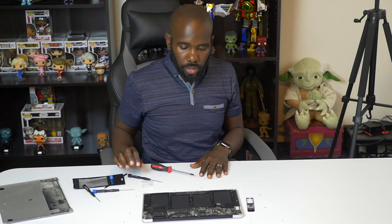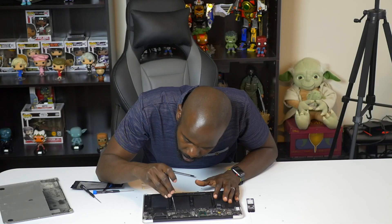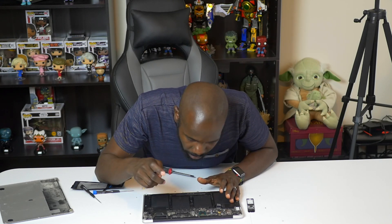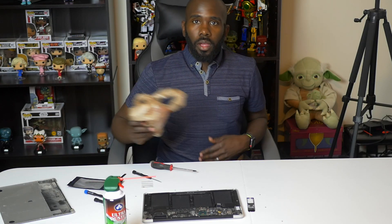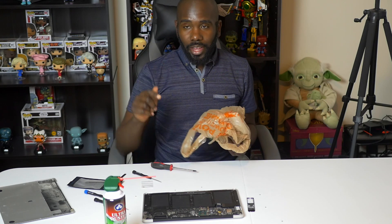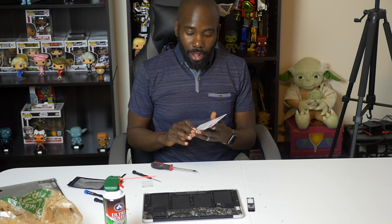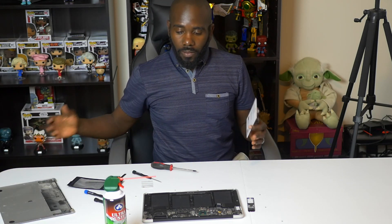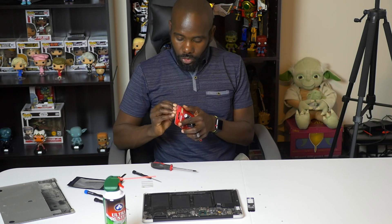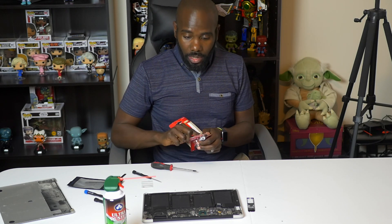This is installed on the board, but I'm having an issue — apparently this might not use the same size screwdriver, which would just suck because I came all this way for nothing. I had to run to Home Depot and get the right screwdriver to remove the hard drive because I didn't do enough research. The outside uses Apple's weird proprietary screwdriver, and the inside uses a regular T5 Torx screwdriver, which I didn't have. So I got access into the system, but once I got in, I couldn't do anything.